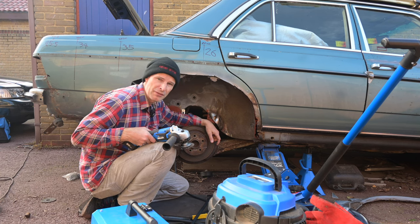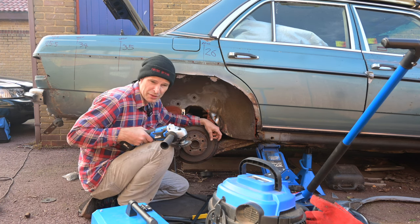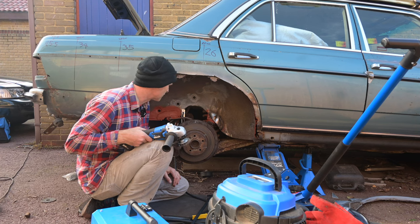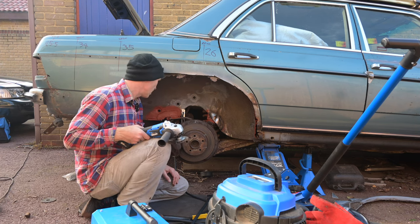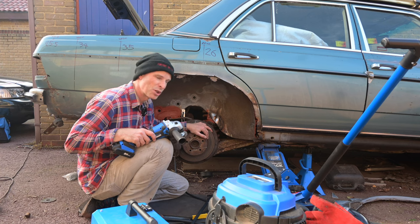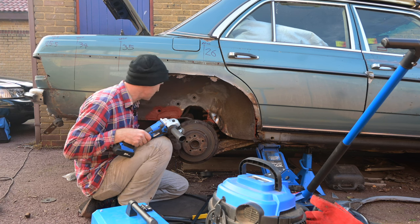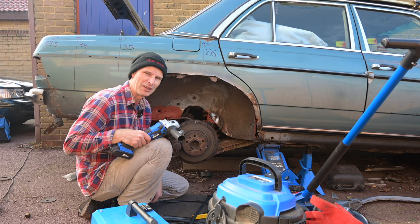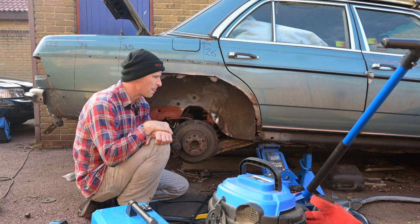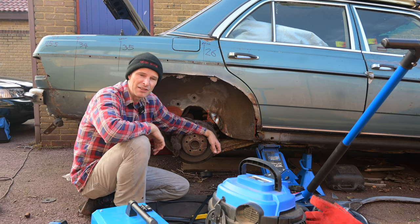The next stages on this car are basically waiting for the new panel to arrive. What I might do in the meantime is go in here with a wire brush — I need to get more wire brush because this one's completely gone — and basically wire brush all of the sound deadening off this inner arch because that's horrible stuff and could be trapping more rust. I want to get all of that gone and then do it properly from scratch. We also need to get underneath the car, wire brush everything, and rust-proof the entire floor, but I'll get this bit welded first and then do the rest of the underside. So this is progress progressing here on the W123 — the car starts, it runs, it's getting more solid, it'll have brakes soon, it'll have a floor soon. Thank you so much for watching; if you enjoyed this please hit like and subscribe. Go back to the beginning of the playlist on this car — it has been a long, long tale. Thank you for watching and see you again very soon.